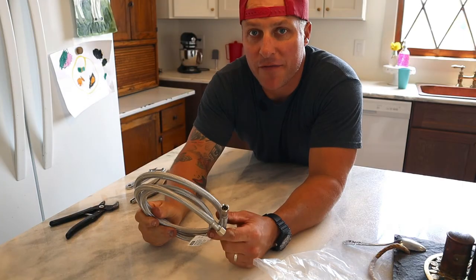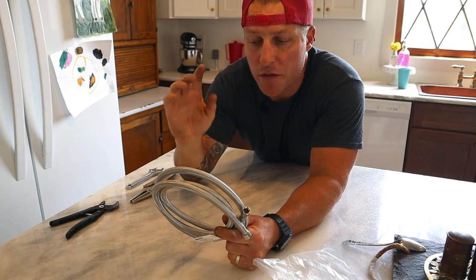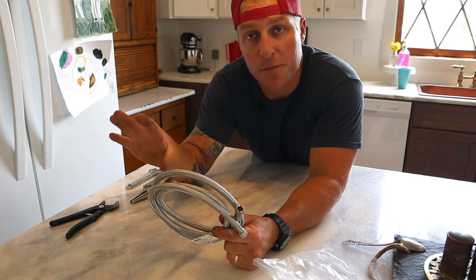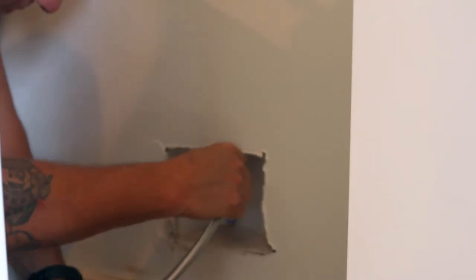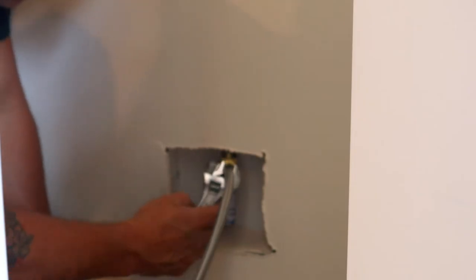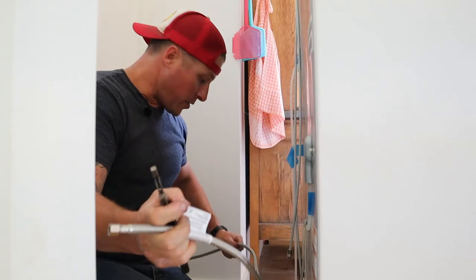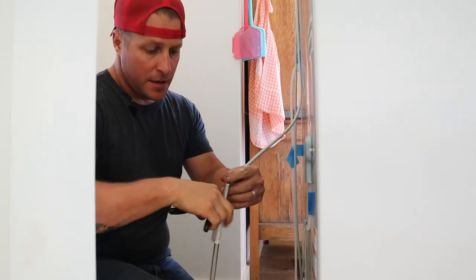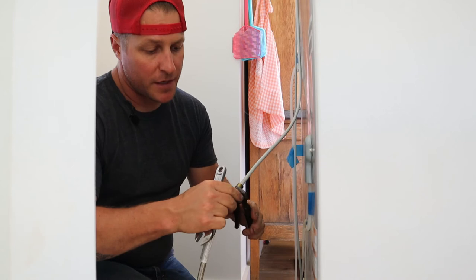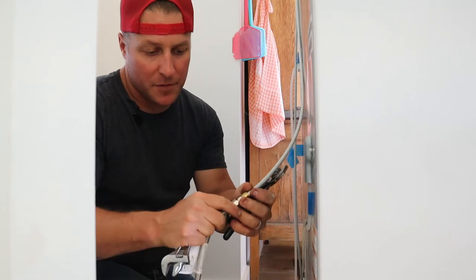I recommend a five-foot line because we do a lot of work and deep cleaning in our house, so the refrigerator comes out of its nook pretty often. The five-foot line gives you enough slack to pull it out, get behind there, assess the line, inspect it, and then simply push it back in. The first end we'll connect will be the wall side — these are super easy; they have rubber compression fittings inside. Do not over-tighten these because it will push out the rubber gasket and it won't work properly. A full turn to a good snug tightness will be plenty. For the back of the refrigerator, before you hook it up, uncoil your line and make sure it's straight. I like to have a set of pliers to hold the line fitting from the refrigerator while I tighten the stainless steel water line — just about three-quarters of a turn after it's snug will be plenty.